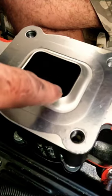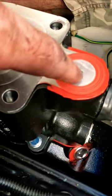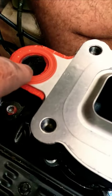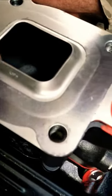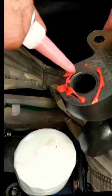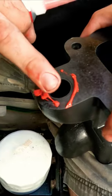When you put this gasket in, the little hole goes to the front of the engine and the bigger one on the back. This flange here goes upward — it has a little word on it that says 'up,' so that has to go up like that.